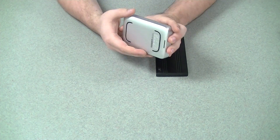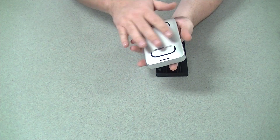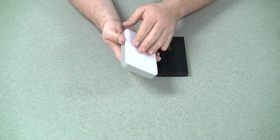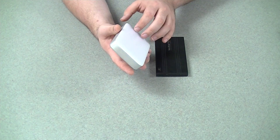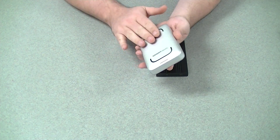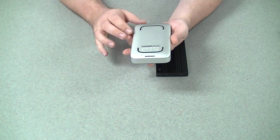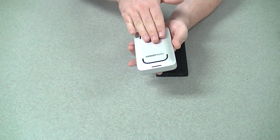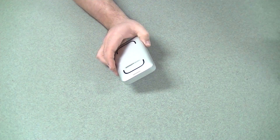The Thunderbolt station is a two-piece design — a solid one-piece aluminum shell for the bottom, and the drive is connected to the top plastic piece. The entire thing is held together with just some double-sided tape along the bottom. So what we want to do is heat up this area, loosen the adhesive, and then separate out the drive.